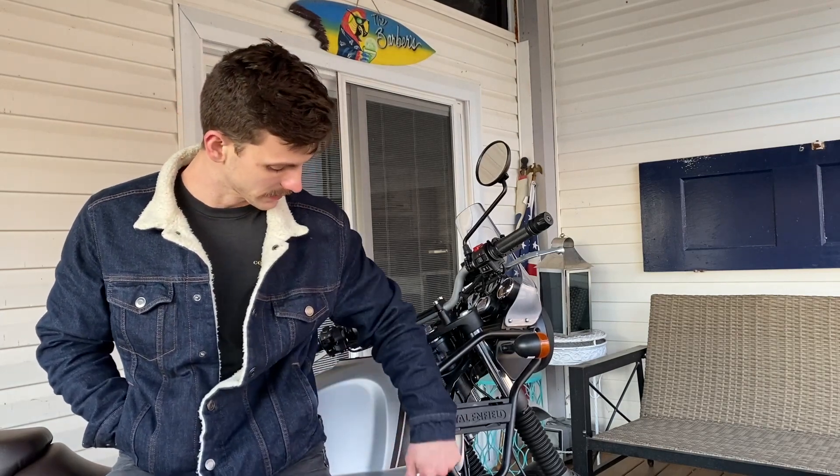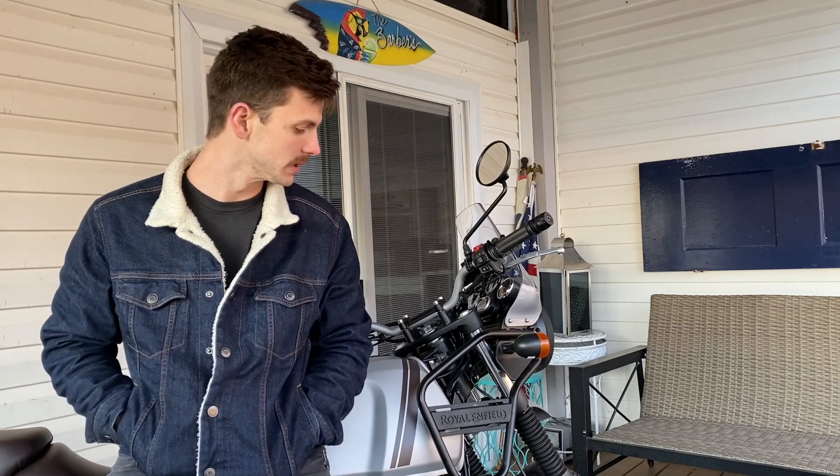Working on your own equipment helps a lot because you know exactly what does what. This was a lot easier than I initially thought. Taking the tank off — I'd never done it before and it took me five or six minutes; that was actually the longest part of all of this. Everything else was really easy, including putting the engine at top dead center. You don't really need to take the side plate off — just put it in second or third gear, take the spark plug out, and spin the engine over with the back tire.